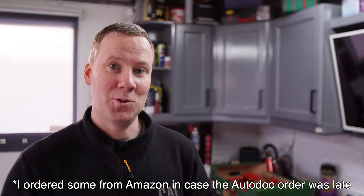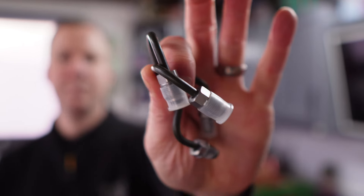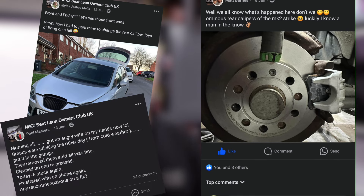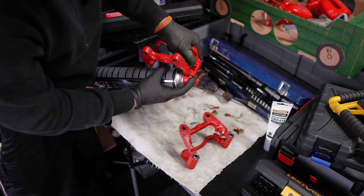I've actually got two pairs of brake pipes now - the short pipes where the caliper meets the brake flexi - because the ones from Amazon came within two days. One tip: if you're planning on changing your calipers or taking them off, that pipe doesn't tend to come off easily - it seems to always break or twist as you take the nut off. I'd always just buy a pair as a backup. It's funny because on a Facebook group I follow - the Mark 2 Leon Owners page - there have been a couple of recent conversations about brake seizure, and these short pipes seem to be a continual pain. For about 15 to 20 quid I'd definitely just have these on standby whenever you're doing the rear calipers.